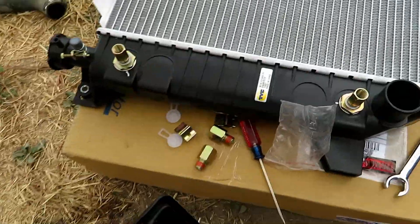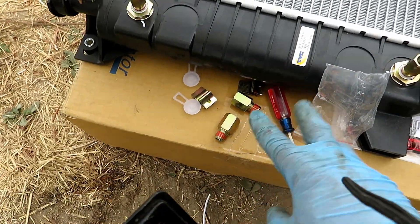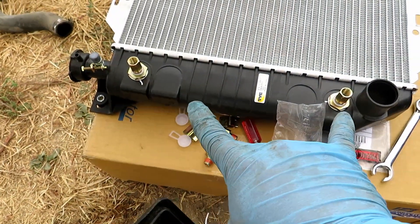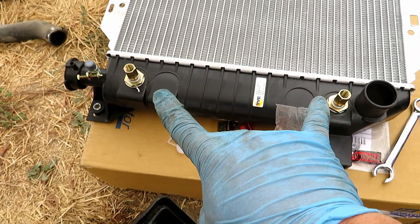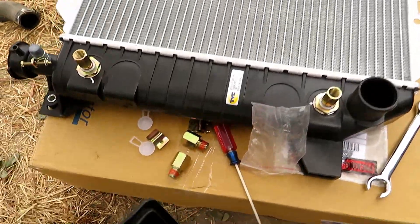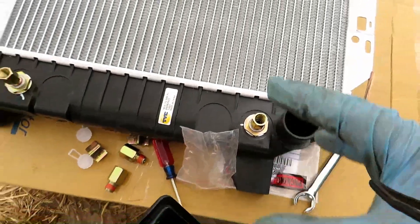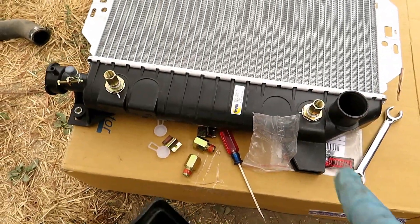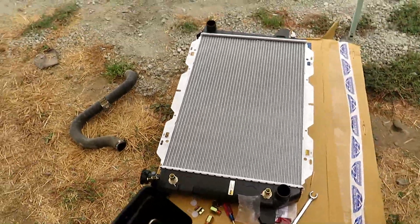It's about time for a new one, so you just have to pick your correct size fittings for the new radiator. These are oversized, made for a heavy-duty truck with a bigger transmission cooler, but this one requires the small ones. They come with o-rings, but these are seal fittings — so you don't need the o-ring to seal it. It's a cone-shaped bevel, so go ahead and take out the o-rings and then you can put on the radiator.